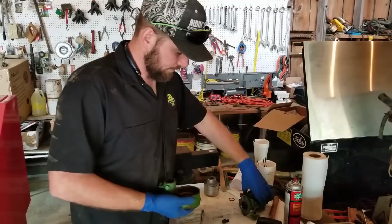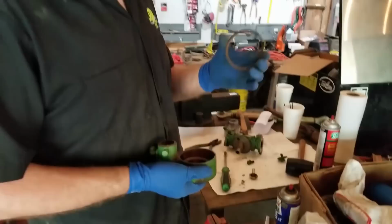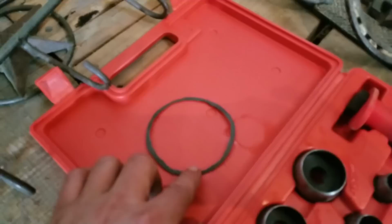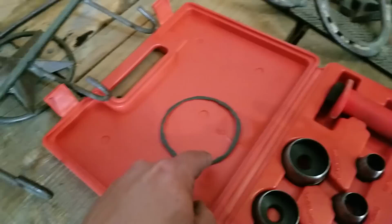Tell me about that gasket there, big guy. Oh, that's not the gasket. That's the old gasket. What's the new one? It's over there, sitting on the table. So Bob, one of my patrons, sent me a gasket maker kit. And one issue we had was that we couldn't cut the inside of the gasket. We didn't have a punch big enough, obviously. And these are big punches. So I just took small bites around the edge, and it worked out fine.